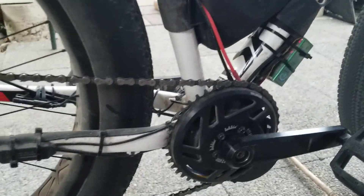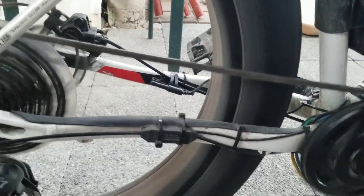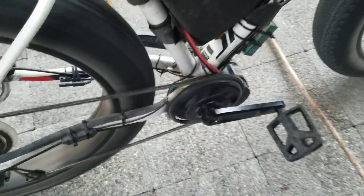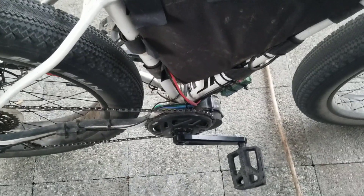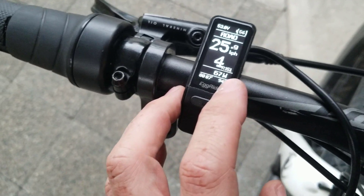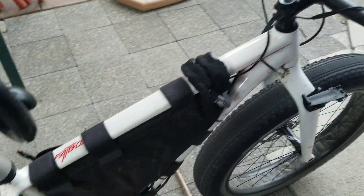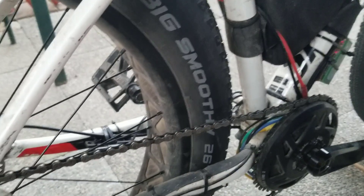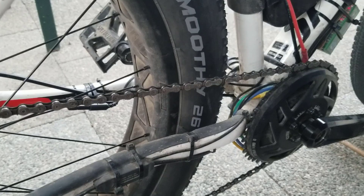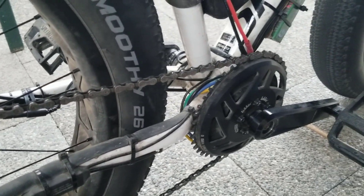The new ASI controller has a neat trick that takes care of that. If I crank the pedal a bit to get the pedal assist going, the motor engages and stays engaged until you brake or hit something that puts stress on the motor. When it starts again you can see it's putting very little watts through the motor — like 67 watts — which won't accelerate you, but on the flat it will move you forward and takes very little effort to stop. What this does is keep the chain tight at all times, so when you come off the throttle the chain doesn't go slack, and when you're back on it's still moving. You're just putting more power through it, which makes acceleration really smooth.